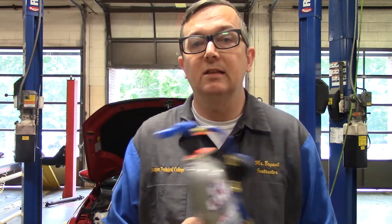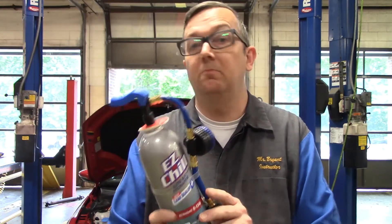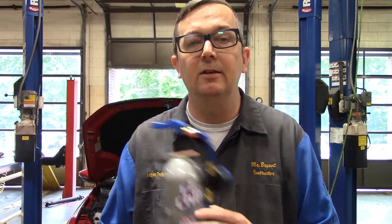If they have a large leak that the leak sealer isn't going to take care of, it's just flowing out of the car, and eventually they're going to have to bring it to you for a proper leak diagnostic and repair. When you get the vehicle, you're going to have a car that is just sopped full of this leak sealant. First thing you're going to do is pull a vacuum or pull off the rest of this can out of the machine, and that sealant is going to get into your machine, clog it up and cause issues with the valves.